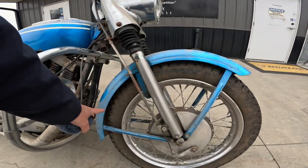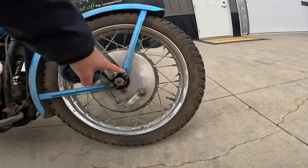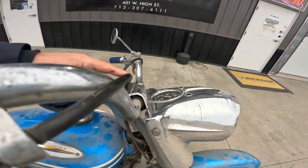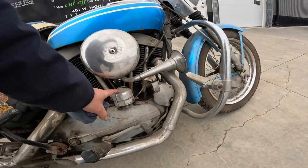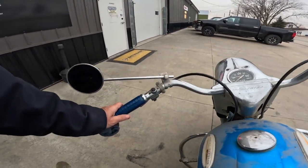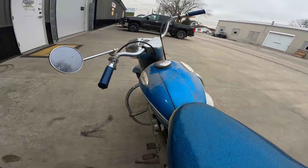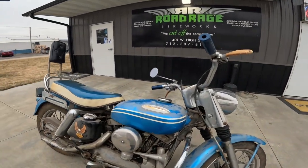The fenders — the newer ones run straight across, but this still has the lower bottoms, just like the forks on the bottom I'm building. Absolutely amazing. That's probably for the odometer — this little knob here. This bike has a distributor right here. It had no automatic advance; to advance or retard the timing, you twisted a knob on the grip, which turned that distributor right there. I think you retard it to kick it to get it going, then advance the timing as you ride — but I might have that backwards, so comment below.